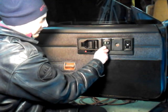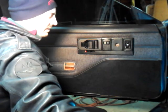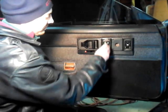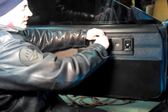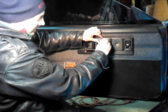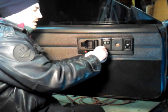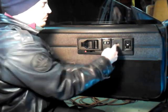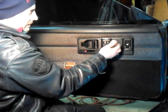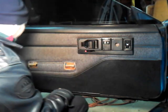Goes here. These are all Torx heads. T15, right? I'll double check that for you. These are T15s. These you can pick up at any AutoZone, Pep Boys, whatever parts store you go to. Alright, tighten all these down. Tighten this one down. Now here goes the armrest, which will hold this whole thing in place. If you're wondering why that's like that, I'm missing two. I'm missing one here and one here. I'll find those later. Let me get you the armrest, and we're pretty much done here.